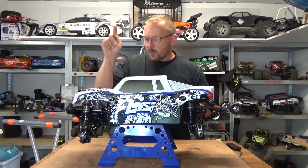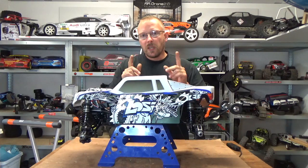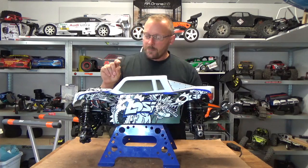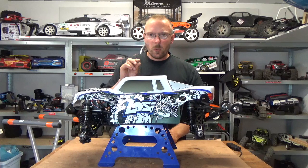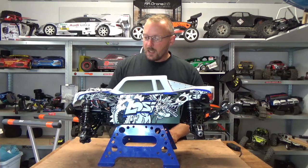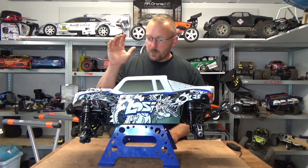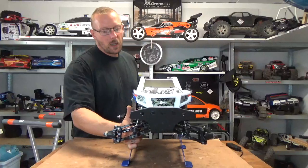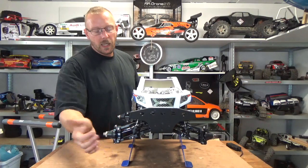After 70 minutes in the woods I killed the front differential. Many people claim it's the planetary pin that is too weak and breaks, causing the diff to be destroyed, but that pin is not the cause. The cause of the differential destruction is that Losi made a design failure regarding suspension travel and CVD angle.